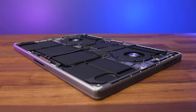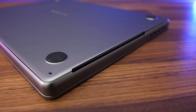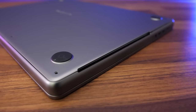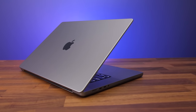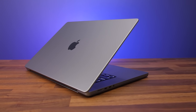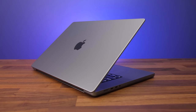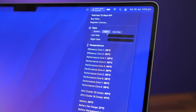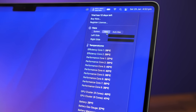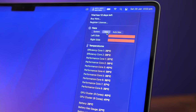Let's check out thermals. There aren't any air intake vents underneath like most other laptops — I'm guessing the side speaker holes double as intake, then warm air gets exhausted out of the vents below the screen. There are no performance modes built in with the M1 Pro model, but if you upgrade to the M1 Max chip you get the option of enabling high power mode for increased performance. There's no way of controlling fan speed by default, however I've installed TG Pro which gives you some basic options, including the option to max out the fans for a cooler but louder system.